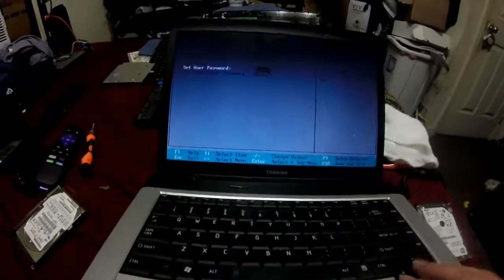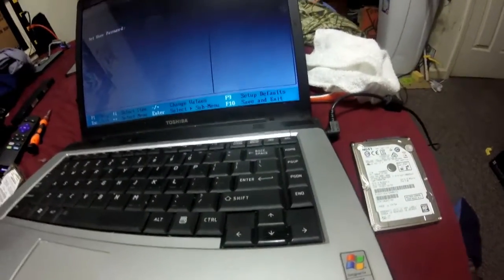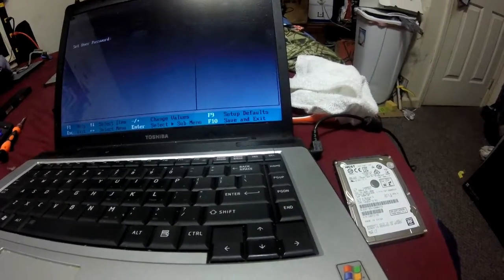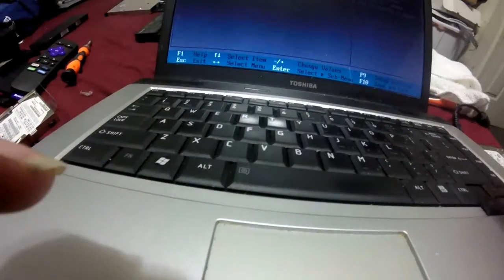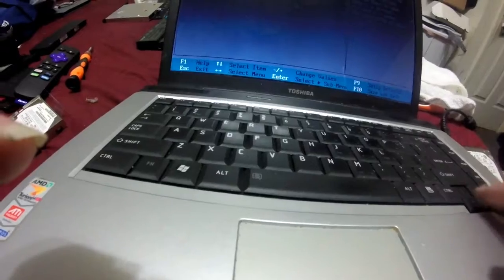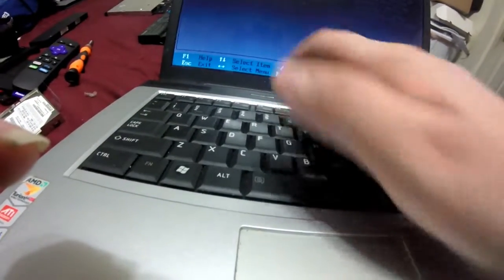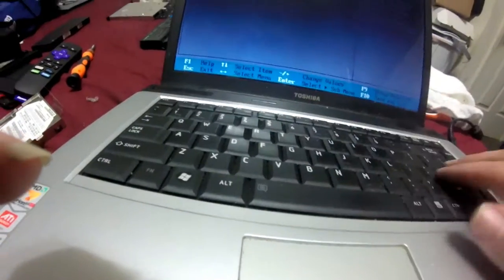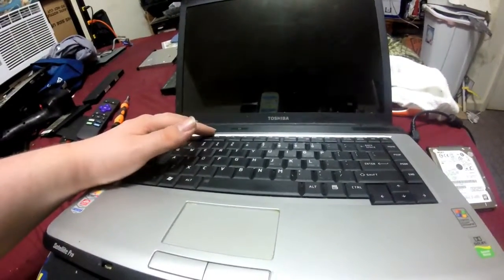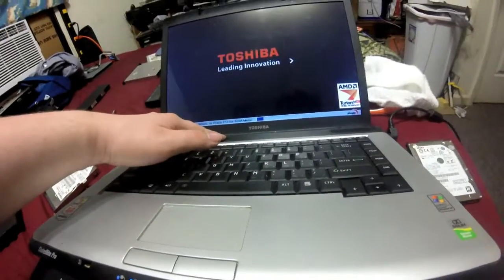As far as I can tell, everything is running perfectly. I'm right now downloading the ISO for Windows 7 Home Premium. I originally had Windows 7 Starter installed — it is so stripped down, it's not even funny. With the 4GB of RAM, it should run pretty nicely with this hard drive. I'm going to set USB as the first boot device because I'm going to be using a USB drive, then exit saving changes. I'll wait for the ISO to finish downloading while I get the hard drive put together. I'll keep you all posted.